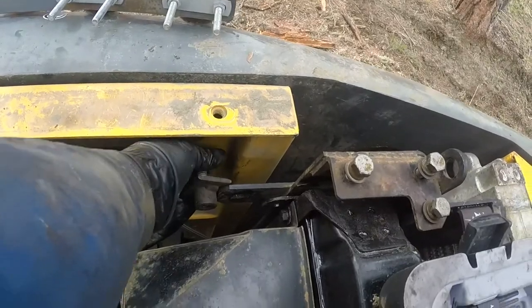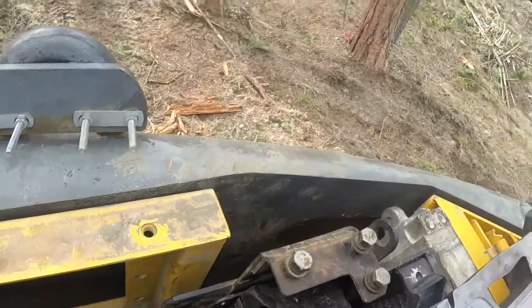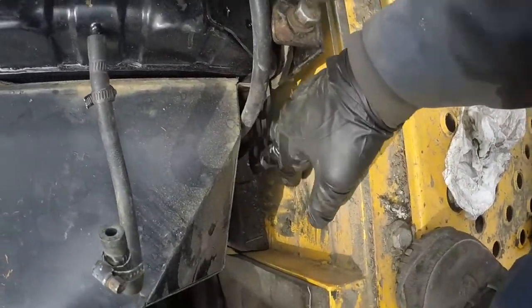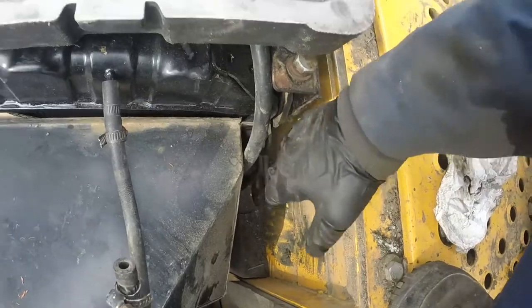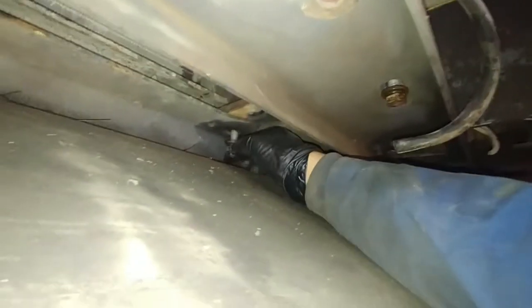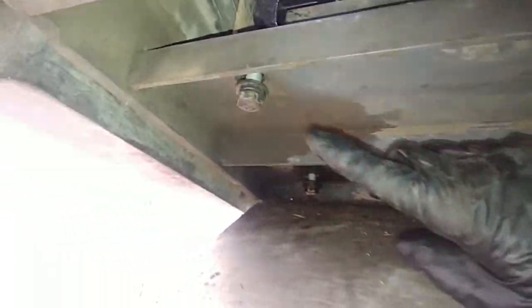Air cooler filter. And yep, four bolts. As you can see, I always put the bolts back. Okay, there is a support arm for the radiator assembly on each side. Now it's time to put them back, and see, you need to do it now, otherwise it might be hard to get. Same thing, four bolts on the bottom, started them up, align all holes, and then we can go and tighten them up.